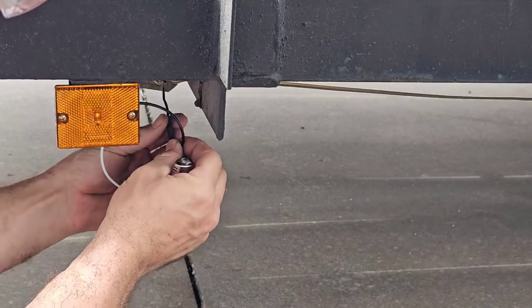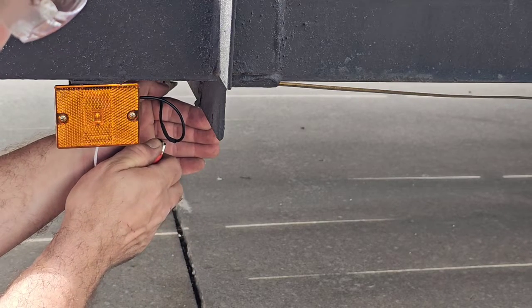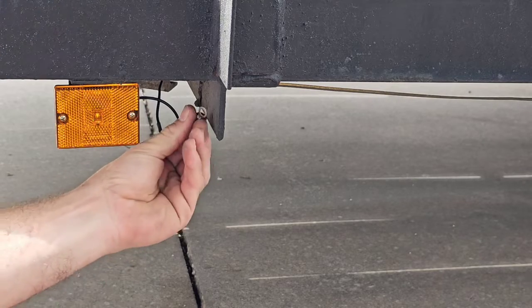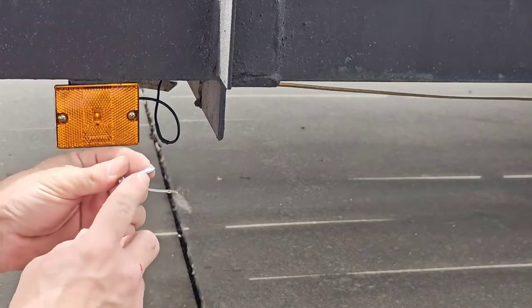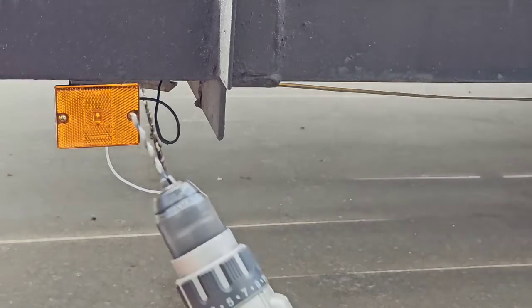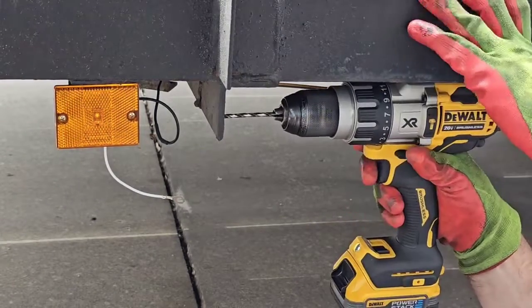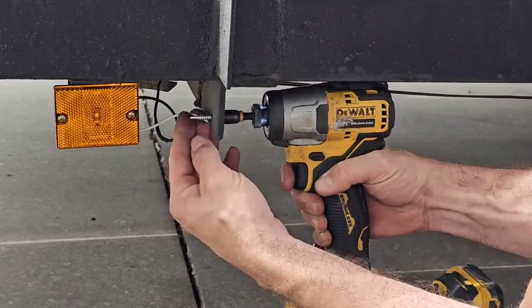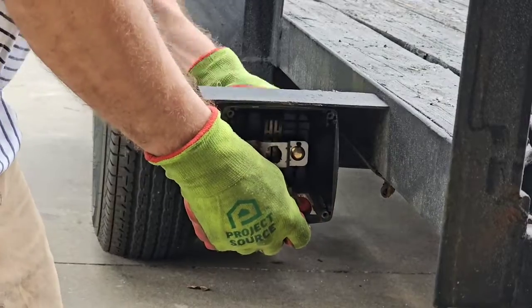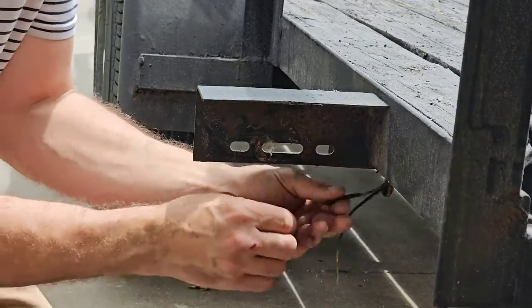I have the wire soldered, and now that it's cool I can slide the heat shrink down on here and just use a lighter to heat shrink it. I have never had an issue after soldering. Now all I need to do is hook up the ground wire. Even though I'm using a self-tapping screw, this material is about three-sixteenths inch thick — probably going to end up breaking off if I just try to self-tap it — so I'm going to run a pilot hole first, and drill it from this side so the light's not in my way. Now I'm going to turn the running lights on and you can see the lights working. I'm going to remove the tail lights on both sides, cut the wires down, strip them, prep them to be soldered. Don't forget to put your heat shrink on before you solder those connections.